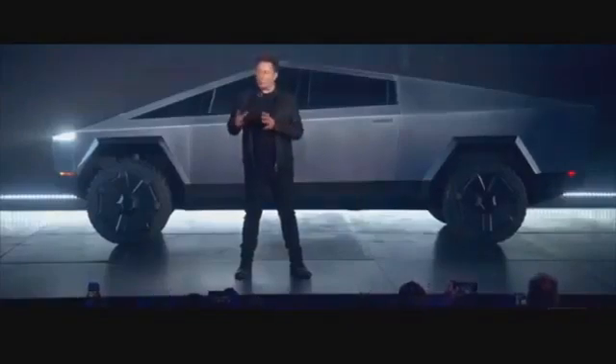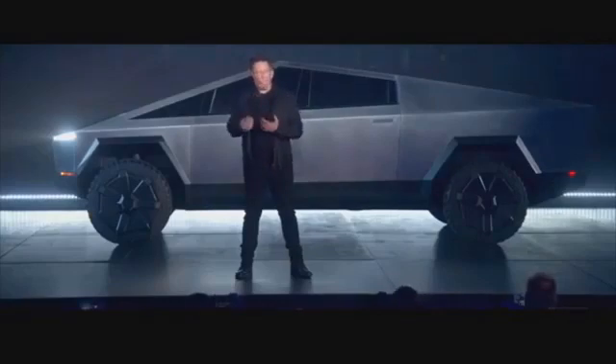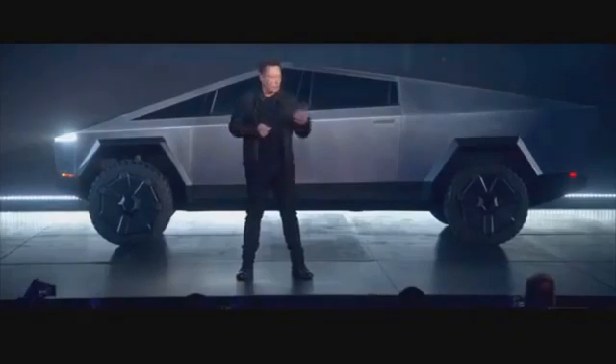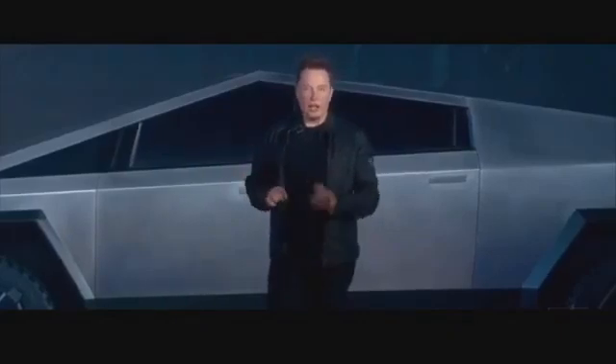The fundamental design change: we moved the mass to the outside. We created an exoskeleton. Normally the way a truck is designed, you have a body on frame, a bed on frame, and the body and bed don't do anything useful — they're carried like cargo, like a sack of potatoes. It was the way aircraft used to be designed with biplanes. The key to creating an effective monoplane was a stressed-skin design — you move the stress to the outside skin, which allows you to do things you can't do with a body on frame.